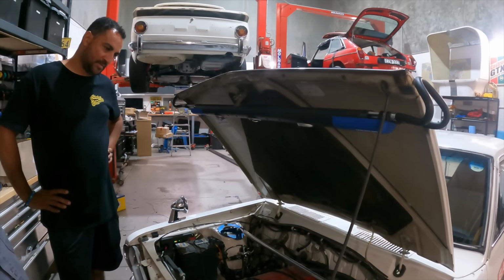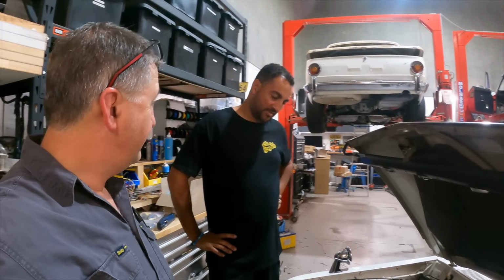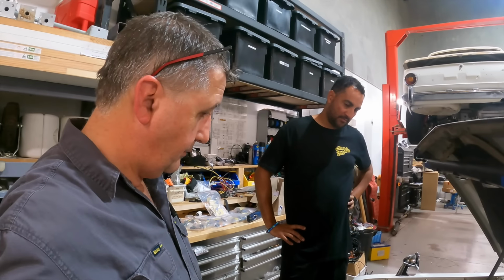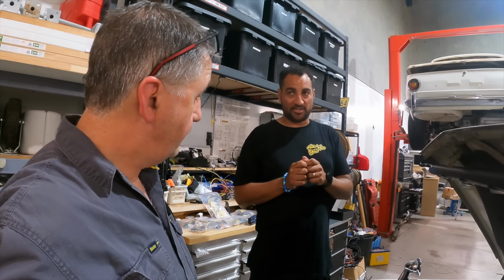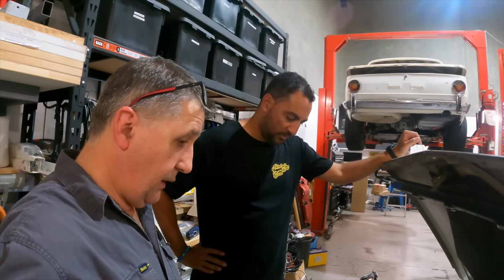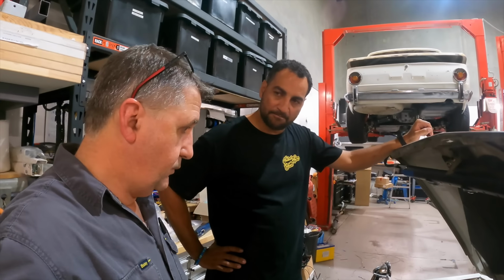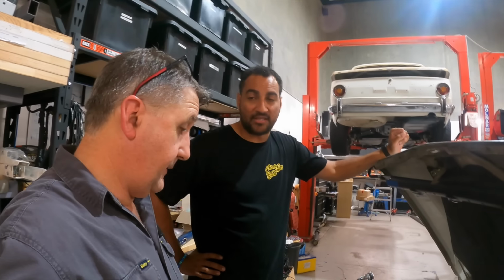Well, I can't wait to drive the damn thing. I was just about to do your brake switch because I just haven't got down in there yet. Brake switch and then put two spade terminals for a clutch switch. I'll just make up a little bracket, and then away we go. We'll configure it, and we're ready to go. Fabulous. Then we'll just need that speed sensor. That's the only thing you need to figure out.